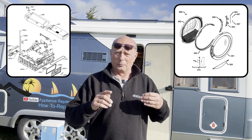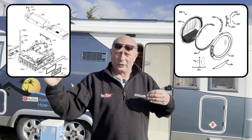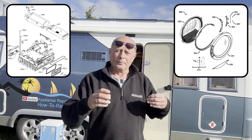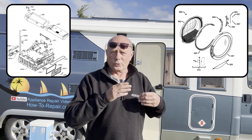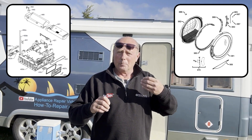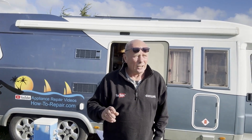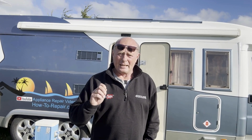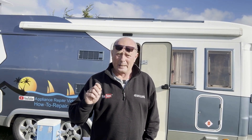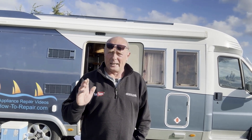You will be amazed how much dust has built up on the evaporator, condenser cooling systems, and the heating system. The way heat pump tumble dryers work is like a refrigeration unit — it uses both sides of the cooling system. The hot side heats the air to evaporate moisture off the clothing, and the condensing side collects moisture molecules out of the air, condenses them into water, and the pump transfers them to the collection tray. Usually these dryers become very inefficient after four to five years. I love heat pump technology, but including it with dust makes it very hard to stop that dust going into the wrong places — which is why all manufacturers are now putting in much greater filtration systems.